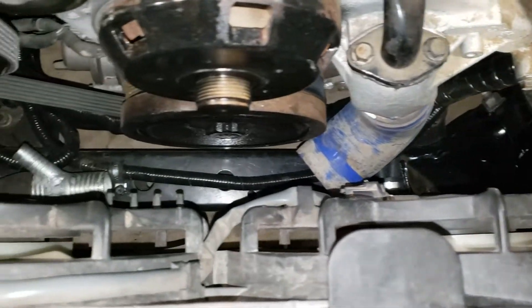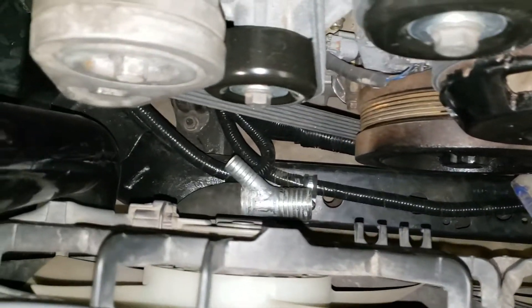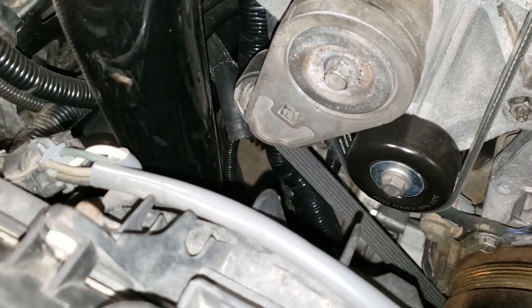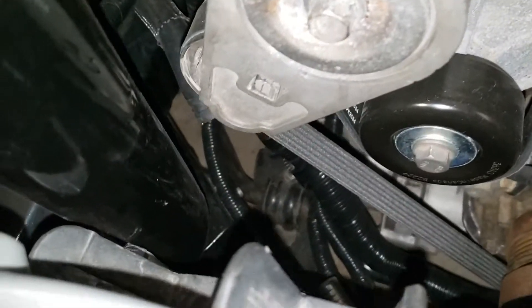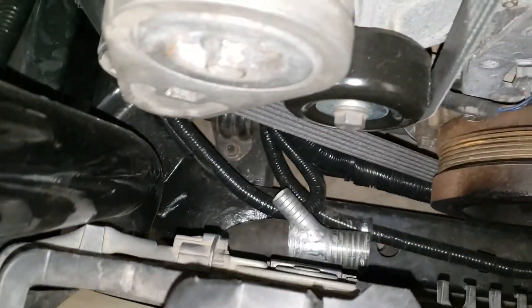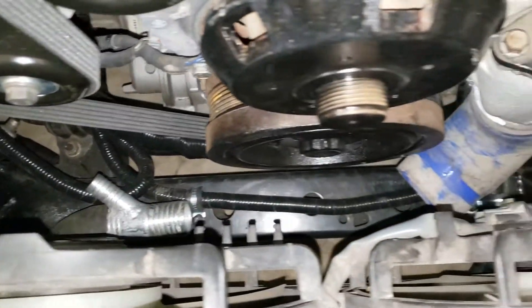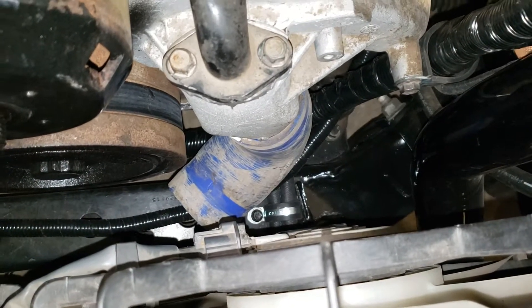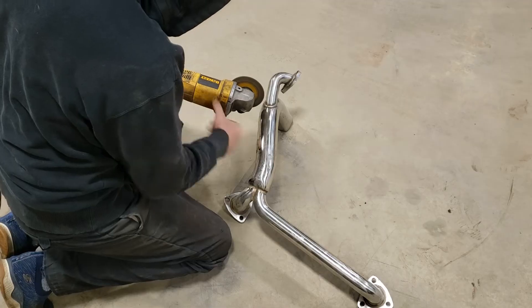So that blue 90 is two and a half inches off the bottom of the water pump. That small hose down there is one and a half inches coming off the bottom of the radiator. And right up here is the heater core line — that's three quarter inch. So all these need to tie together. I'm thinking just a metal pipe going across: two and a half on one end, and on the other end will be a one and a half and a three quarter barb.